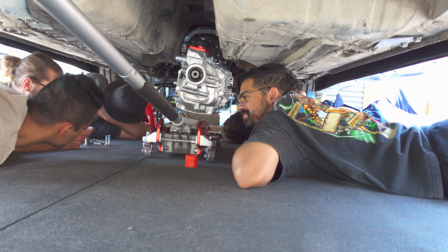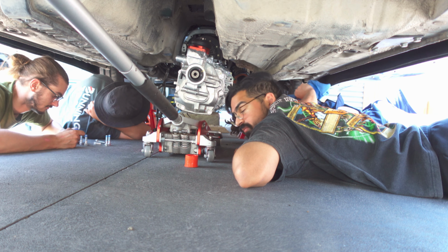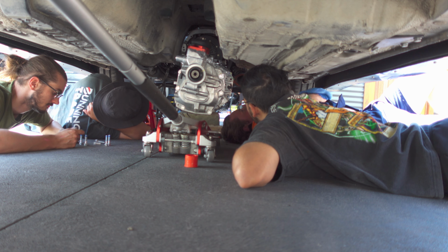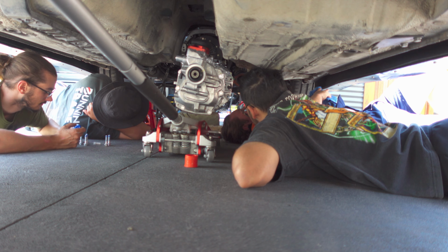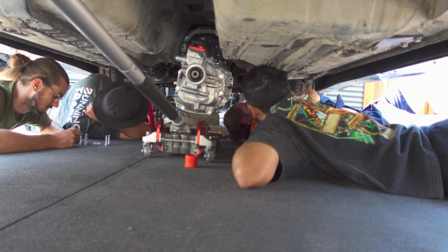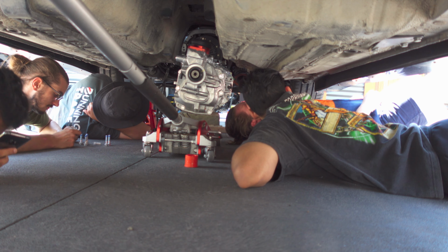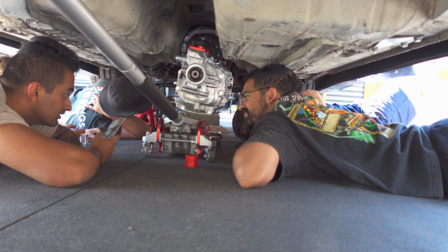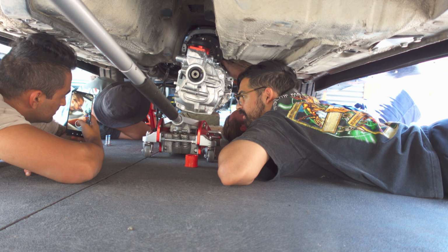Okay, so once we're through both clutch discs, which we should be able to feel, he recommends 2 of the easy side bolts. Get them started, don't do them up, but just get them started so that to get it into the pilot bearing right up the front, it'll be a bit easier if it's not moving. Like the bolts will kind of line up a bit. But just do finger tight, just start threading them. But he says you don't want to be pulling the gearbox in by the bolts.